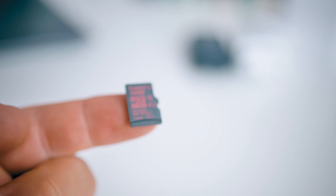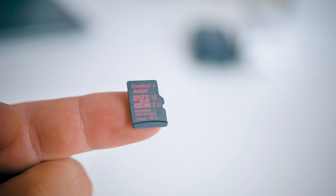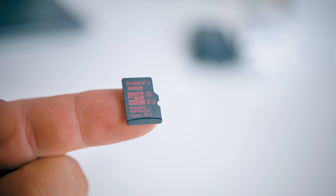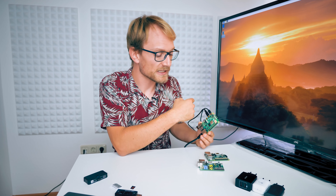I did all this testing with the newest OctoPi image — the one that runs on the Raspberry Pi 4 — fully updated as of August 8th, 2019, running off of a Kingston microSD card, a UHS-1U3 card, so it's a pretty fast card. One thing that's really cool with the Raspberry Pi series is that you can just take one image, one install, and move the SD card between generations and it's still going to boot up. I used the exact same image on the Raspberry Pi 1 as I did on the Raspberry Pi 4, no issues at all.